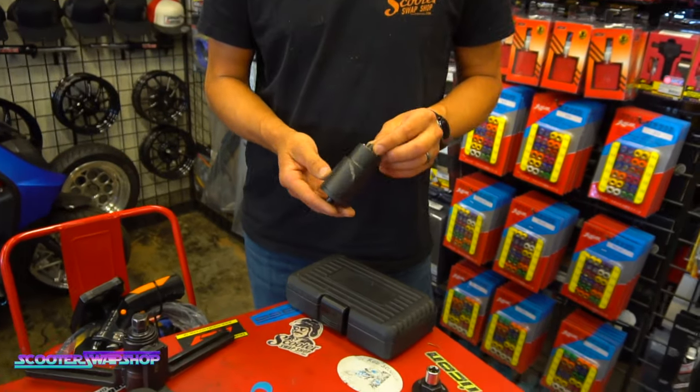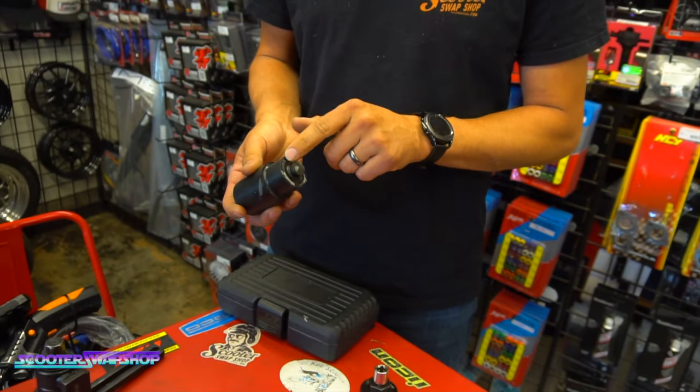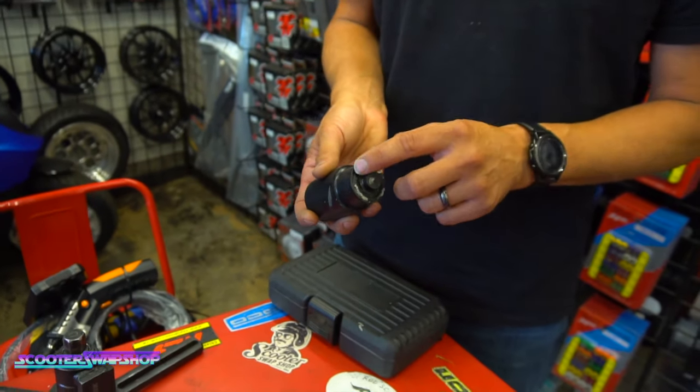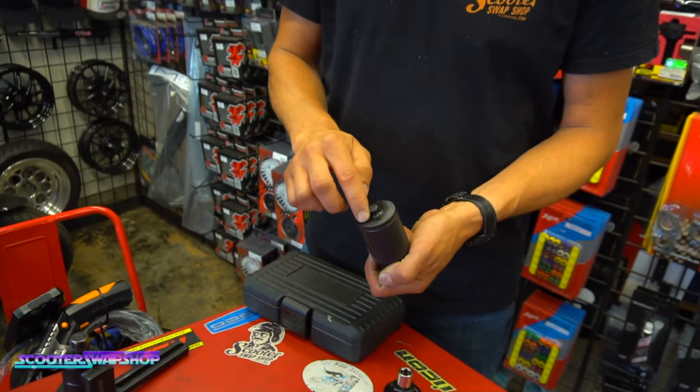We do a lot of RC1s here. This is just something I machined down out of Delrin on the lathe. What I've done here is create one side to drive one bearing in, because we heat the cases up, drop bearings in, and this can push one bearing in. This size is to push another bearing in, and this size is to push another.